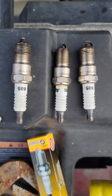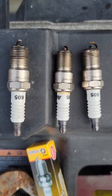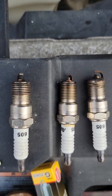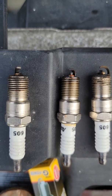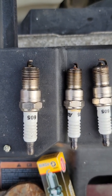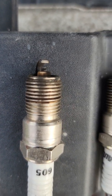So I believe I have a dead plug right out of the box, you guys. So if you ever run into a misfire and you fix it, just go back to your original repairs, which would have been the spark plugs and wires. And we can see — I had a thought that it was that metal plug, which would be number two. But you can clearly see that one's been firing.